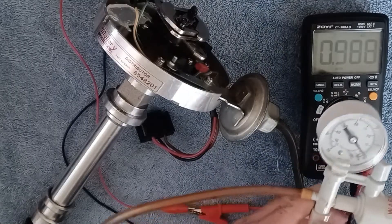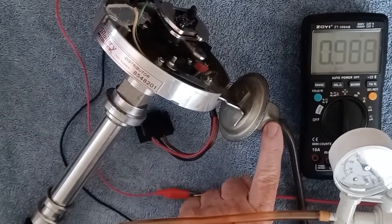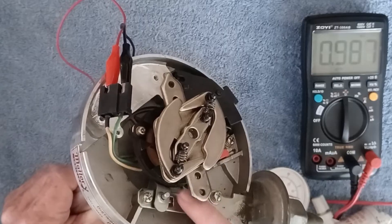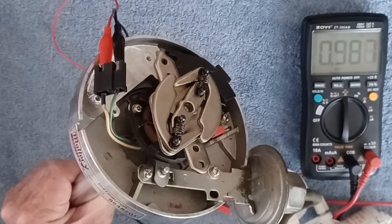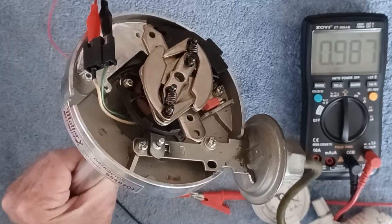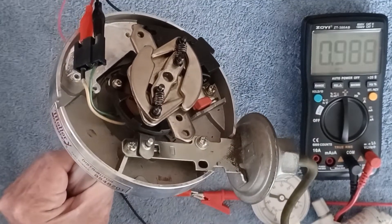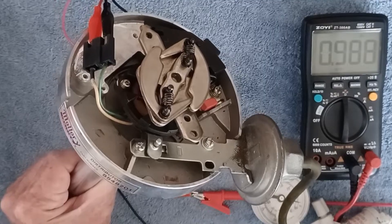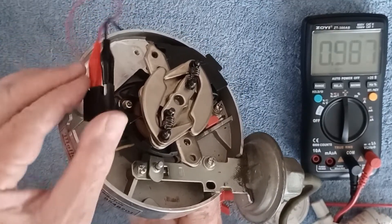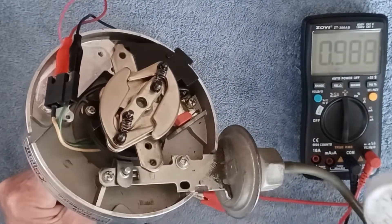Something I'd recommend is using a MightyVac — a little hand vacuum pump — attached to the vacuum advance unit of the distributor. That vacuum advance unit pulls the pickup coil to change spark timing in relation to engine load, and over the years and miles, hundreds of thousands of times, this wire flexes back and forth as the pickup coil moves. So it's not a bad idea to also add a wiggle test — moving the wires and watching the ohm meter for any changes.